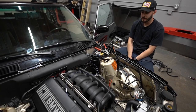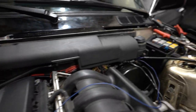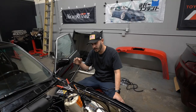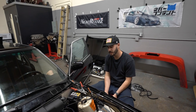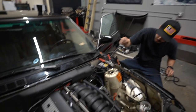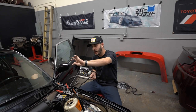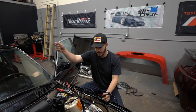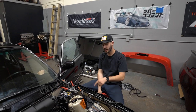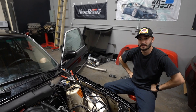The cover bolted up — it's a pretty tight fit. We had to make some modifications, but this is from an M3, so it's definitely not going to bolt up the way it's supposed to. We have an M52 in it so it's going to be very different. I'm taping up some of the red power wires, and doing the same with these blue wires — one is just a ground, oil temp sensor, and then coolant temp. So wherever that goes, probably under the manifold. It's coming together but just a lot of work — probably another hour and a half just trying to clean things up before we can start it.